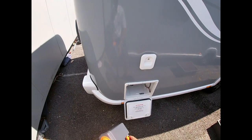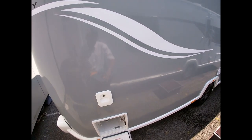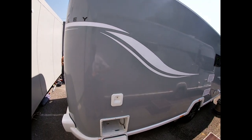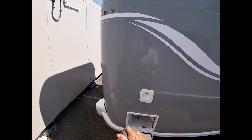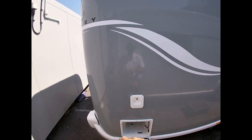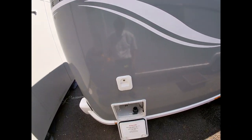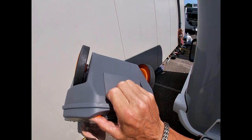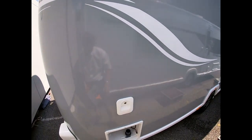Once you've got that out there, you can either wheel it off or carry it off to what is known as an Elsan point, which is a waste disposal for toilets on every caravan site you'll go to. Once you get there, give it a good shake up to break down the contents, turn the spout, removing the cap, putting it somewhere safe, well away from where you're about to empty the toilet. Once you've done that, spin it round, press the little air release button, and you can empty the toilet out like so.